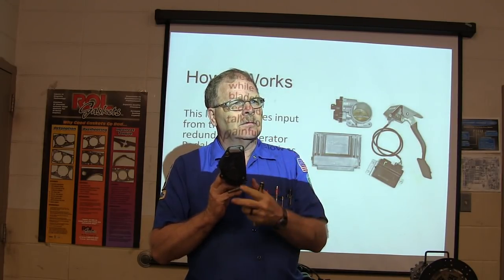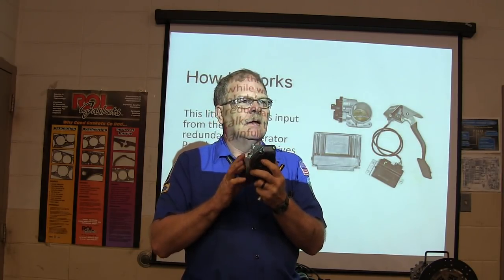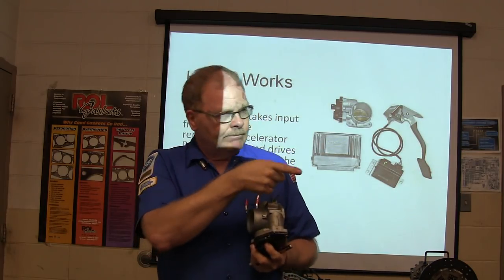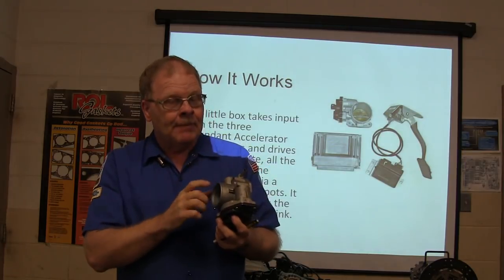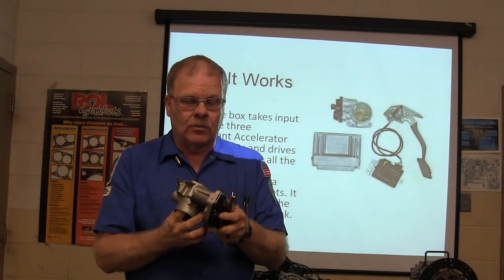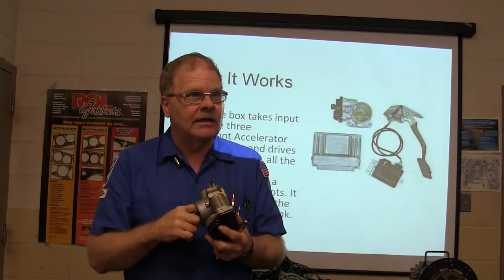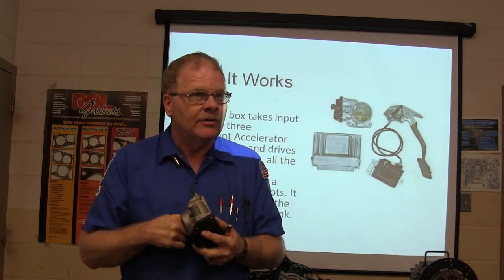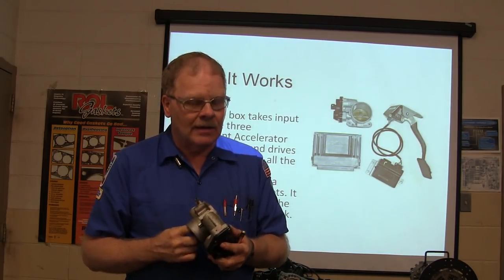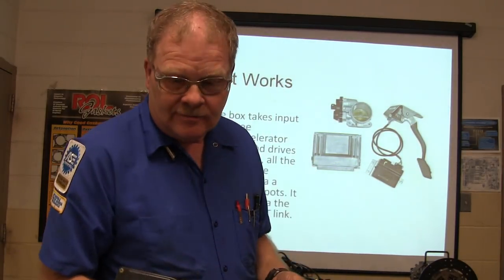Didn't you say something about one of the dual enrollment students in Geneva doing that? I did, over there in Drew. He actually came over here and said, my throttle body doesn't work right. I said, did you open it with your finger when you were cleaning it? He goes, yeah. I said, did I tell you not to do that when we were doing engine performance? He goes, yeah. I said, now you're going to need a throttle body. So he went and got a throttle body. I never heard from him since then.